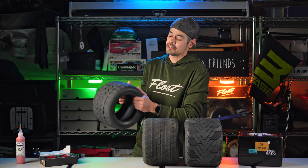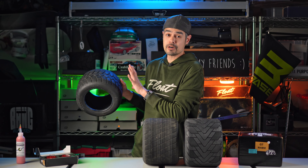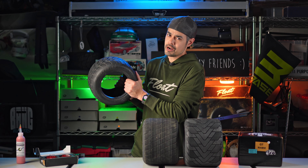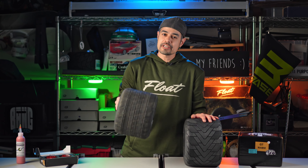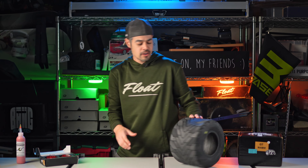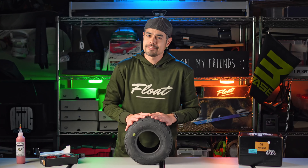So when the GT came out it was rough. This tire was rough, very hard. If you had crappy streets, trails with a lot of chunk, this was very unforgiving to ride on. It's perfectly fine if you have smooth ground, smooth asphalt, you stay on the sidewalks where you don't deal with any bumpy terrain — this tire will last you forever because it's a hard compound. Softer tires with more sidewall give you more suspension on your one wheel. So not only is that great if you're doing drops and riding on chunky trails, but it's safer. Being able to get not only a soft compound tire but this much sidewall means that when I ride out here in the chunky Arizona trails, if I mess up a little bit or try to go over some really technical terrain, this is going to save my butt.